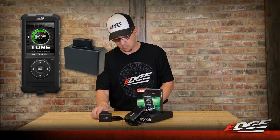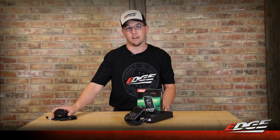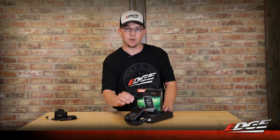We basically plug the Locksmith OBD cable into your truck. The Locksmith connects to the other end, and the EvoHT2 connects to the Locksmith. It will walk through the unlock process to allow flash tuning in your ECM. Once the unlock is completed, the Locksmith can be disconnected and set aside and will not need to be used in the future ever again. You can then use the handheld tuner to directly plug into the truck and flash the pre-calibrated tuning from the tuner to the truck.